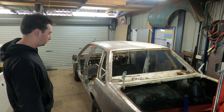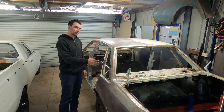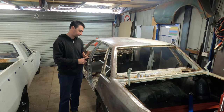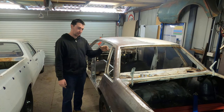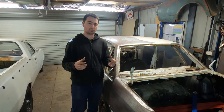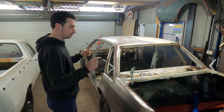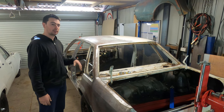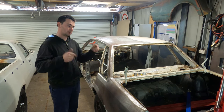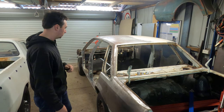So it's actually going to stay four-link with a panhard. But because of the way the tub goes, you end up deleting the factory spring and the factory shock mounting positions. So what that means is you have to mount an inboard coilover - there'll be a link bar between them, coilover tabs, coilover will mount to that. We'll cover that later. But today we're actually going to get it up on the rotisserie because I need to cut the tubs out and that's a prick of a job when it's on the ground. Strip everything out of it - it'll make my life a lot easier.